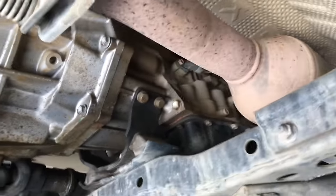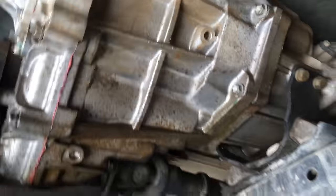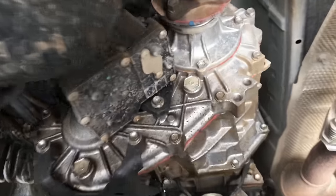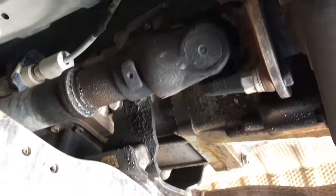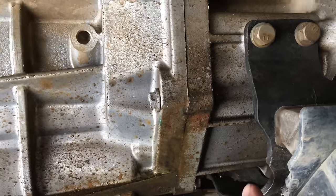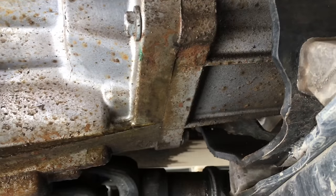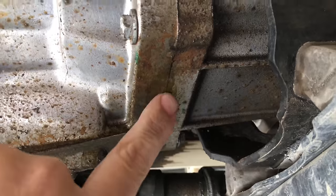It's a 2012 and we've noticed there's a slight issue — this isn't what we call an oil leak because as you can see there's no drip of oil anywhere, but it's a bit untidy. See this sweat back here? Because of the wind blowing from the front to the rear of the vehicle as you're driving, it's pushed the oil backwards. We look towards the front and going forward we can't see any oil anywhere forward of this join here. So it looks quite obviously like the oil may be sweeping slowly out that join there.